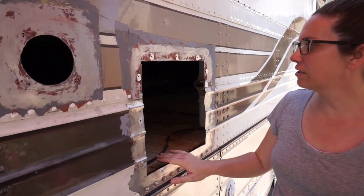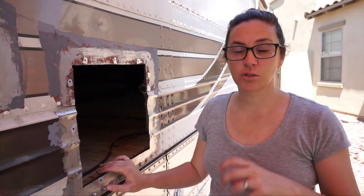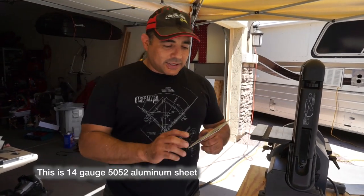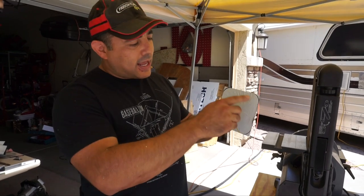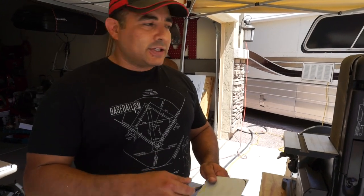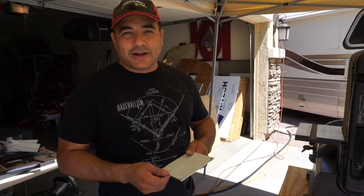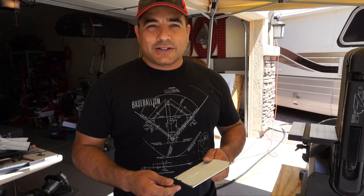Both of these surfaces are ready. We're going to drill our rivet holes into our piece of aluminum and then move on to the next step. We're going to cut kind of half circles or rounded edges in the metal just to make it look a little bit nicer. We'll be using a jigsaw and then finishing it with a bench grinder. We've already cleaned up the area and gotten it pretty much ready to go, so we'll cut the metal, drill the holes, and then attach it.